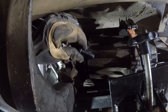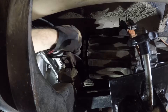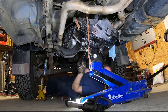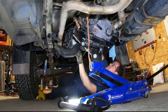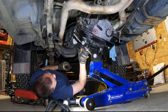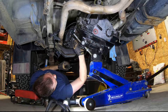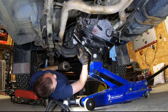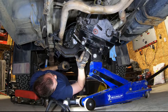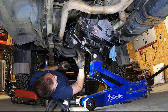On these, just add a little bit of blue Loctite to them. We got the strap off, we got three bolts in, they're snugged up. Much like a tire, use a criss-cross kind of a torque sequence, just to draw that flange in nice and flush so it doesn't create any binding. Now we can lower this jack out of the way so we can get the other bolts a little better.